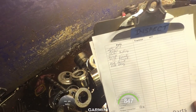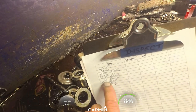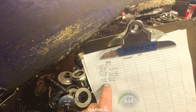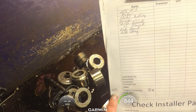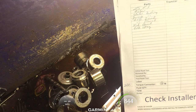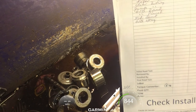Alright, that's what we're going to do on this one: LS kit, filter, and try the bushing and the stator. If not, we're going to buy a stator. Pump bushing, overdrive band, overdrive planet, intermediate band - the overdrive and intermediate band are the same, I just separate them so it's easier when writing up parts. Overdrive sprag. And the only letters I can make out on the torque converter were 2AC - there should be another letter but it was burnt too bad. Hopefully that's good enough for the converter company; if not, go off the fin angle.